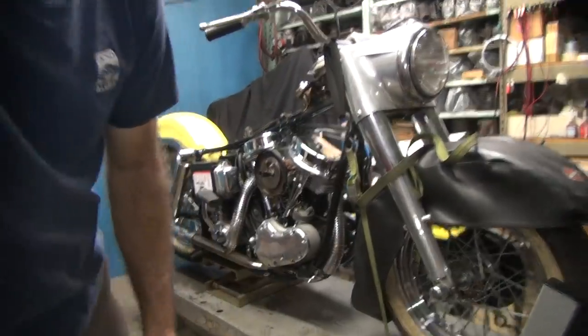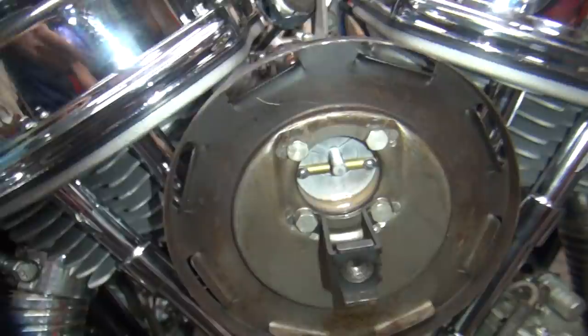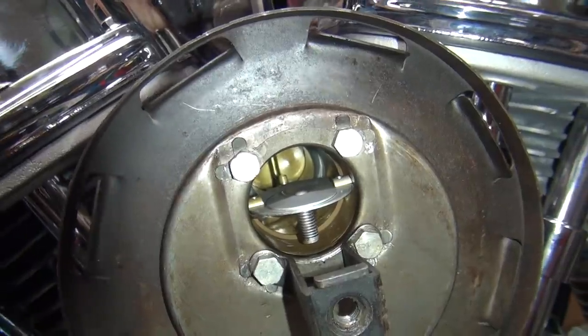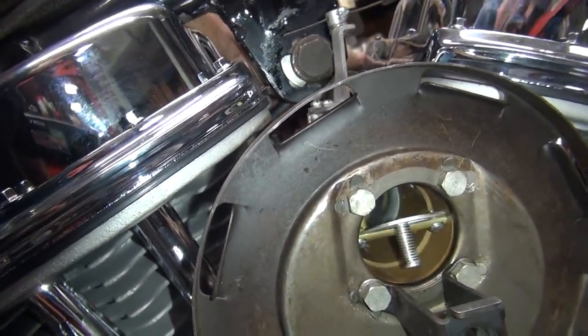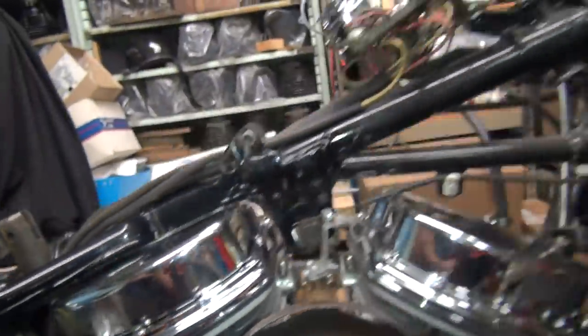We got Scooby. Scooby's going to try to help. So see how they've already got fuel all through here? That means we got gas in the carburetor. Yep. So that means you got good suction on the rings. Okay, I'm going to give it half choke. We'll see if that's enough choke.